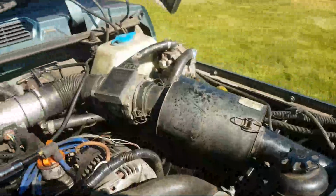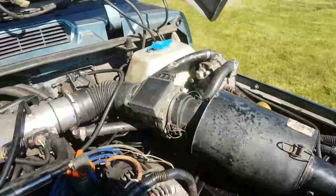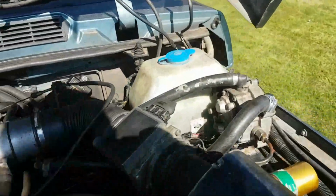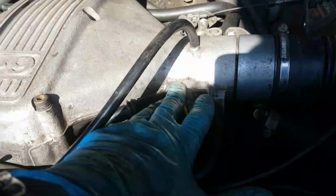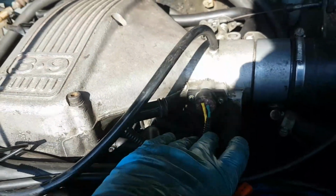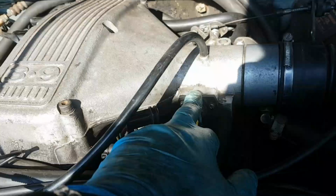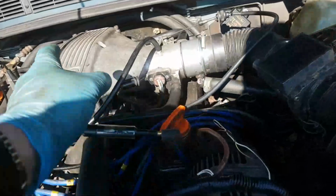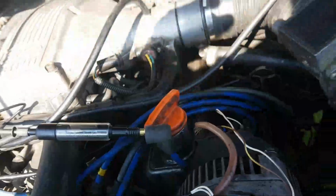So by this point, I'm pulling key components out of this car, which shouldn't affect the starting. The only one I found that should affect the starting is this one here, because on Rover gauge, this has gone open circuit and it's detecting the throttle as 88%. So that's going to overfuel, which is why it's disconnected. There is a fail safe.